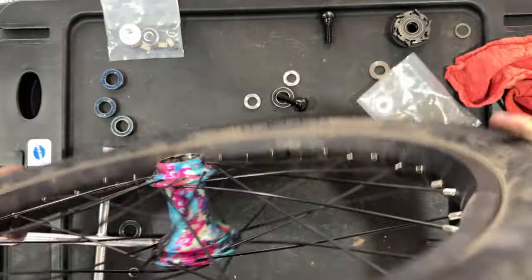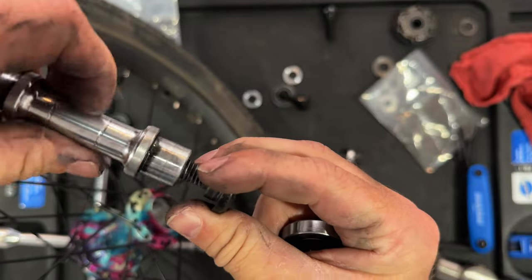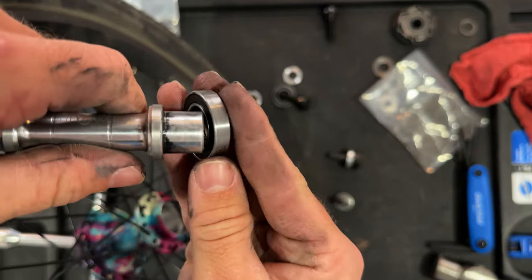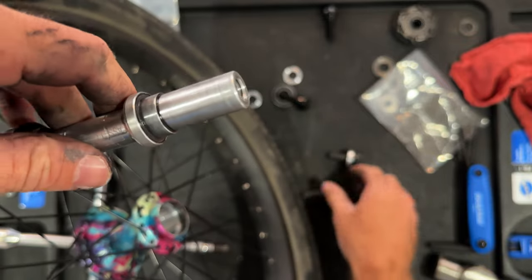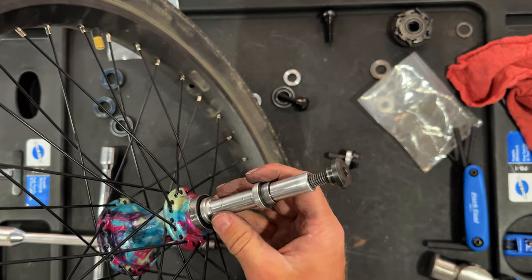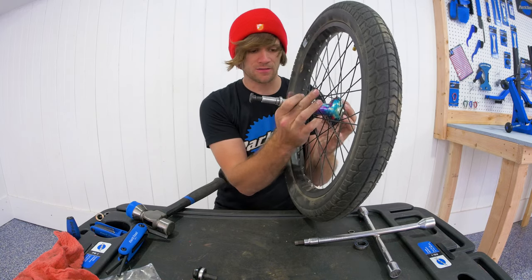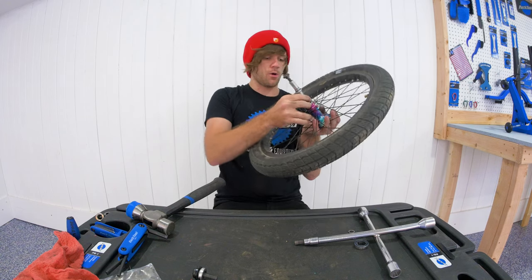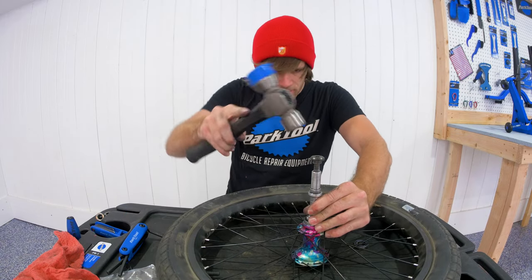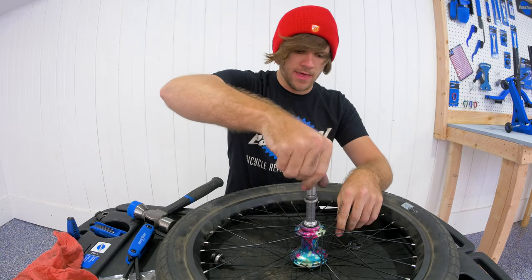Bearings are out of both sides of the hub. First, I'm going to loosen the non-drive side, take the axle bolt out, and put the bearing onto this side. Then we'll flip the axle, put the axle bolt into the drive side, and put the bearing into the non-drive side first. This is the one that allows us to make sure the bearing is in here and that our axle and everything is aligned properly when we're putting in the drive side bearing. Making sure this is horizontal with adequate support — and just like that, that bearing is in.